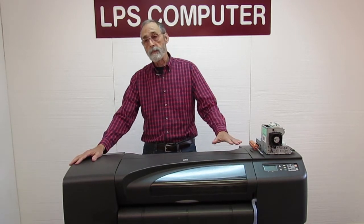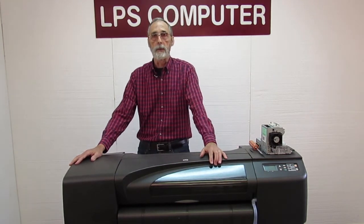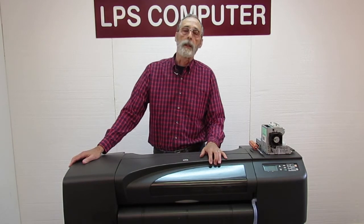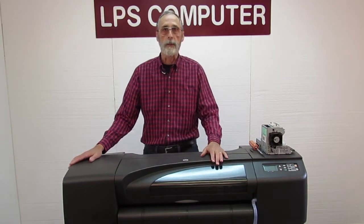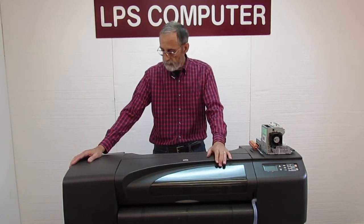And after the ink is in, you can do the same thing with the print heads. Sometimes one print head will cause all the print heads to show bad. The reason being, they share some signals. So if one of them is fouled up, it can drag them all down. It can even make its neighbor look bad without showing itself. But you can usually pick them out by putting them in the machine one at a time, taking them back out and going to the next one.